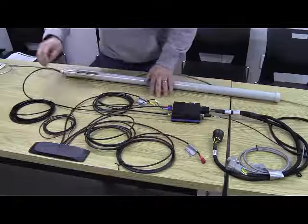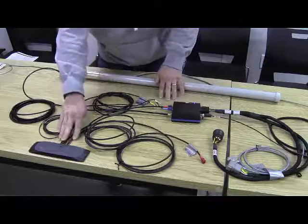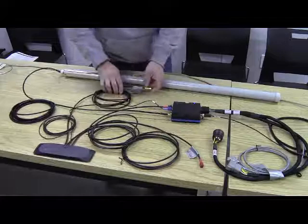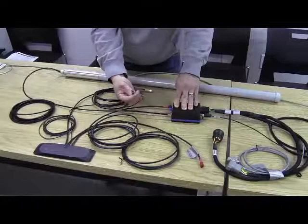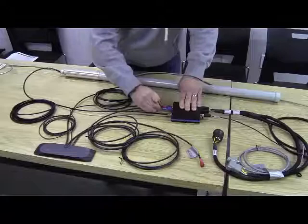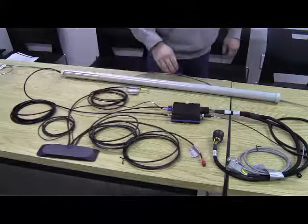There are only two plugs on that cable. The other antenna plugs into the CL55 with two wires. There are four wires coming out of this antenna — the red plug is not used and the yellow plug labeled Wi-Fi is also not used. You're going to use the blue plug, and on the CL55 both plugs are blue, color-coded to match. They're the same plugs, so it's very easy to connect. The two unused wires can just be tied off out of the way.